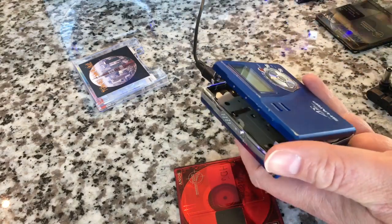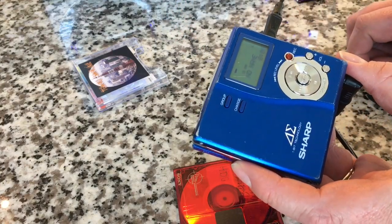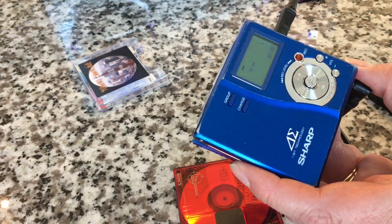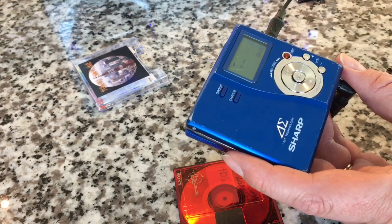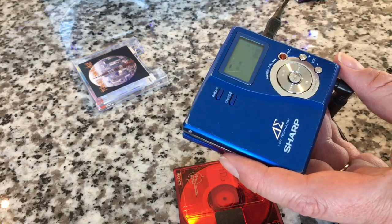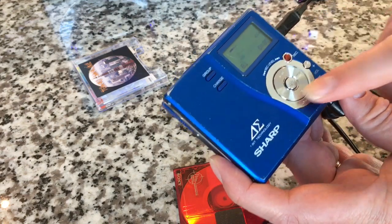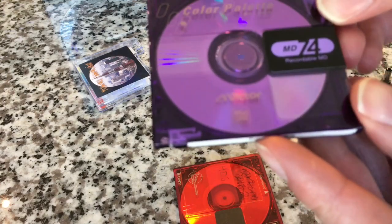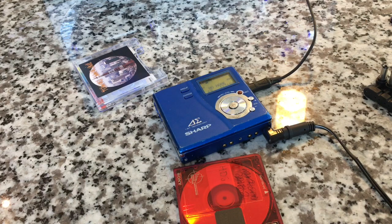Let's try out an LP disc. This particular disc was recorded in LP mode — let's verify it's working. You see TOC when they start — that's table of contents. In mini disc world, the table of contents is everything to a disc, because it's a random access memory format, kind of like a computer hard drive, where data is stored in little bits here and there and everywhere, randomly accessed, buffered, and played back. And there we go — it works in LP mode. This is LP 2, which doubles the playtime of a regular 80 or 74-minute disc. LP 4 gives you four times the playtime — hours and hours of playback with really good sound quality.